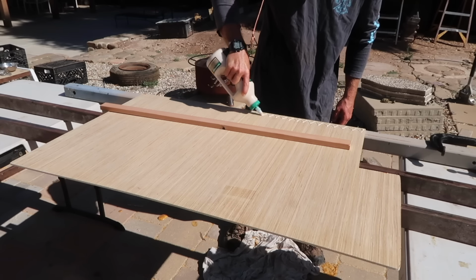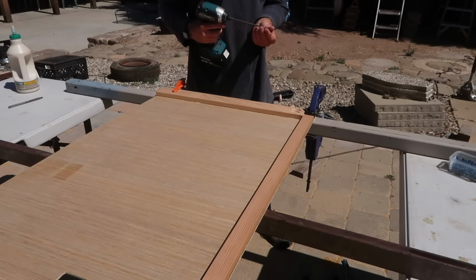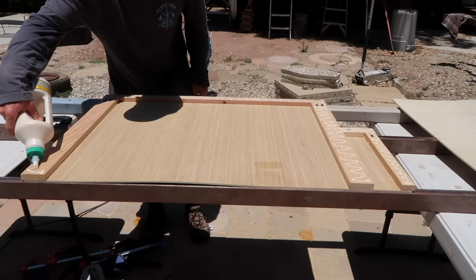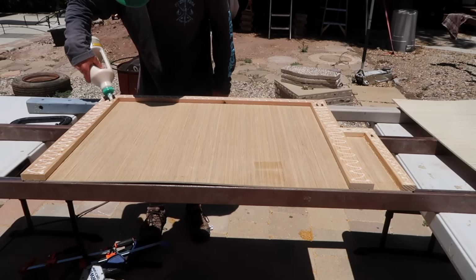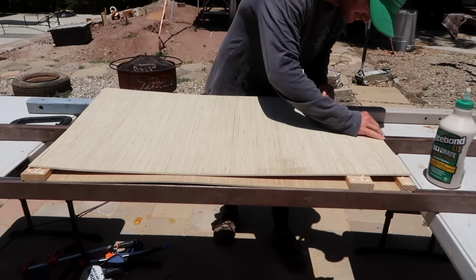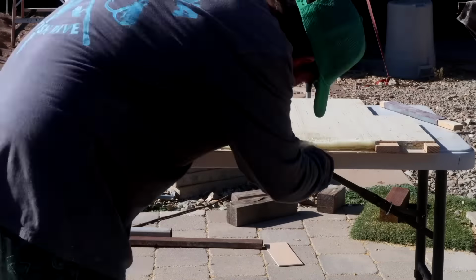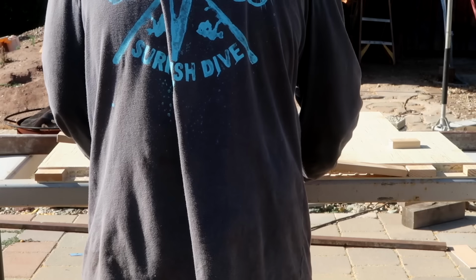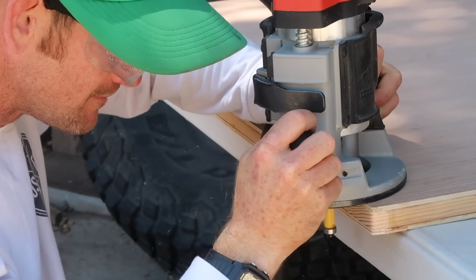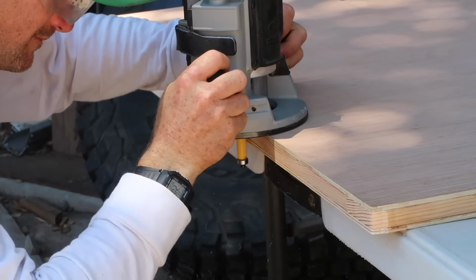I started by cutting some 5mm plywood into the shape of the utility hatch door. Then used exterior grade wood glue and pocket screws to build and attach a frame of 1x2 and 1x3 Douglas fir. I used the 1x3s running from the hinge edge to each of the latches to add some extra strength in key spots, and so that I would have a large enough area with wood core to mount the latches. With the top sheet of plywood glued to the frame, I filled the voids with polyurethane pour foam. Then cleaned up the excess pour foam and glued in the last piece of frame and the final strip of 5mm plywood. Then ran a router with a flush trim bit around the edges so that my door panel has a nice smooth wood edge all the way around.